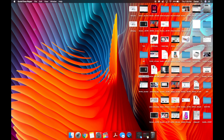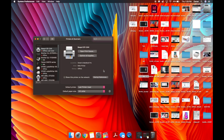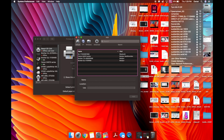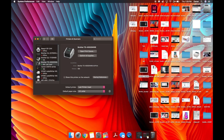Here we are on the MacBook. We're going to go to the finder up here, type in printers and scanners, and go to this top hit — printers and scanners. Double click on that — it brings up your printers and scanners settings. We're going to hit the plus button right here. Ignore all these other printers. The printer is popping up — make sure you are on the same network that you connected your printer to, and it should pop up like that. Highlight it, and down here it's going to say use AirPrint. Hit add, and just like that your printer is installed.